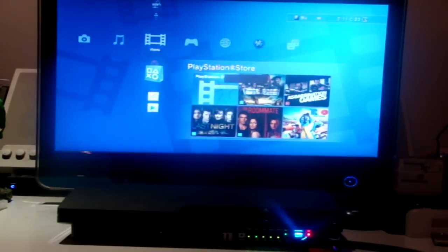Okay, the downgrading process is nearly finished as far as the E3 flasher is concerned. Might just wait it out now. While we're waiting here, I'll let you know some of the rest of the process. The next step, this will automatically shut down. After it shuts down, we'll reboot the console. It should come up with "please insert your controller via the USB cable." We're going to flick the switch on the back of the PlayStation, shut it off and then reboot again with the downgrade dongle in the PlayStation.